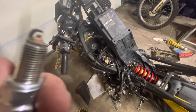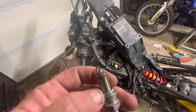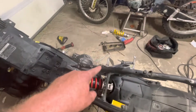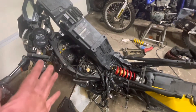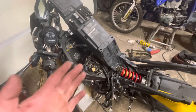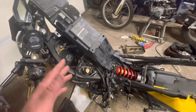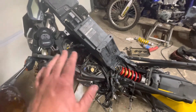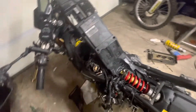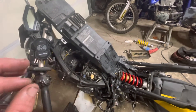What I see here is 100% normal, probably a tiny bit lean, but I don't think so. Here's my reasoning: a lot of people think that if you put an exhaust system on your bike and don't get the ECU flashed, it's gonna run lean — that's not true. It has an O2 sensor and a MAP sensor, so no matter what, your engine — unless you've done something specific to your ECU or ECM — the factory settings will always adjust for atmospheric conditions and what the engine is doing. It was running fine.